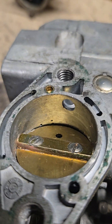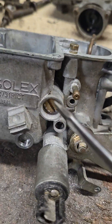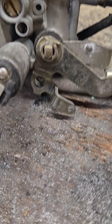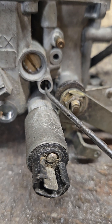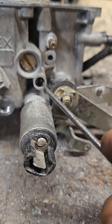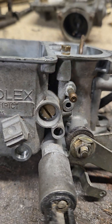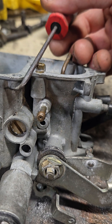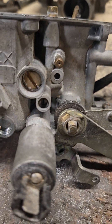There is one caveat when setting the pilot jet and air correction jet — whether dual port or single, this is the speed screw. After putting the right pilot jet in, if you screw this all the way in it'll die, and if you keep screwing it out you'll reach a point where you get a smooth, fast idle. That's the highest speed you can obtain by moving the screw. You keep backing it off to richer and it should change again. That means the pilot jet is sized so you can adjust it too lean and too rich, with the sweet spot in between. You want a range — bad lean, bad rich, just right in the middle.